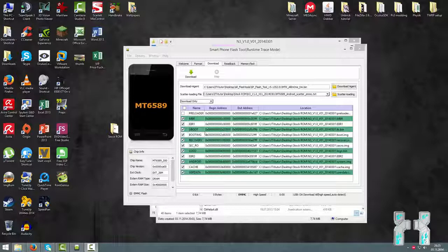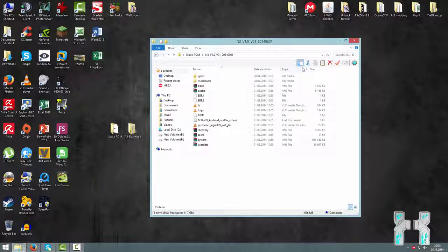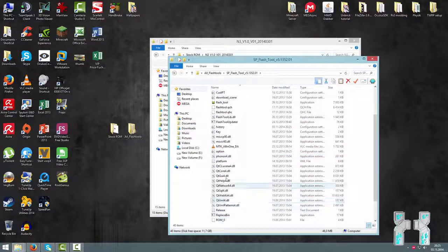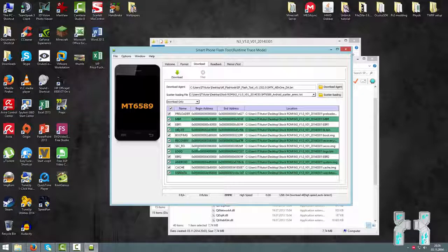After the flash is successful, you get a 'Download OK' message — close that and close SP Flash Tool, then disconnect the smartphone. Before rebooting, make sure you reconnect the battery, otherwise it may not boot. If you solder-bridged contacts on the mainboard, remove that bridge too. There's a possibility you may be stuck in a boot loop — try going back to SP Flash Tool and formatting the whole flash except bootloader, then re-downloading the ROM. Also enter the recovery and wipe cache and user data, as there may be a problem with those partitions.